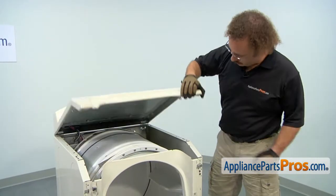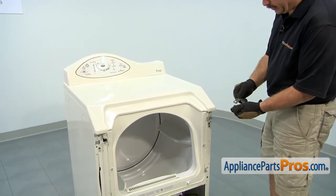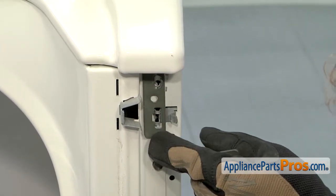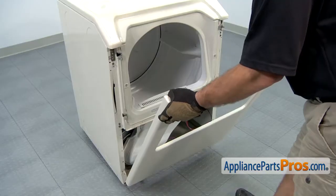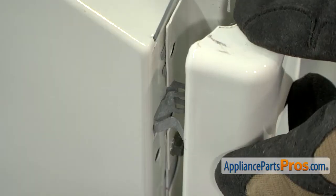We can lower the top down — we want to make sure that the little plastic lining pins go into the holes. Then we can replace the metal brackets. Remember you want to make sure that the hook points towards the outside, so you want to put it on and rotate it in. Once you have it in place, you can use your 5/16ths nut driver to put the screw back in. We can put the front panel back on. You want to make sure that the holes on the lower panel go down onto the brackets, then we can rotate it up and make sure that the locking brackets on the top snap in the holes.